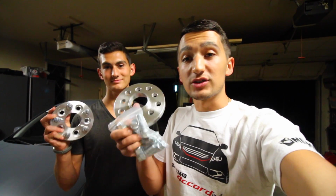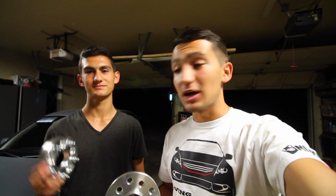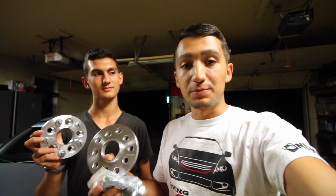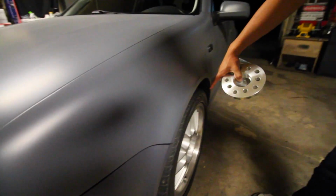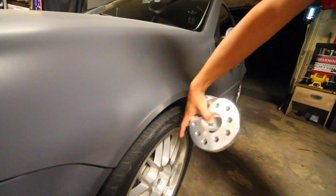Welcome to another episode. Today in this video, we're going to go over the differences between wheel spacers and wheel adapters. Now, in a previous video, I showed you guys how to mount up wheel adapters on your car. I labeled them wheel spacers, and they basically do the exact same thing. All they do is extend where the OEM wheel sits on the car. On the Volkswagen Golf we have right here, the wheel is tucked into the fender. By installing either a spacer or an adapter, we're going to be able to extend the wheel and push it out so it's flush with the fender.